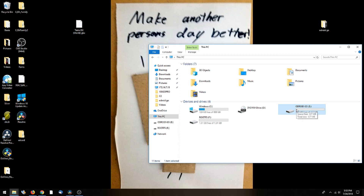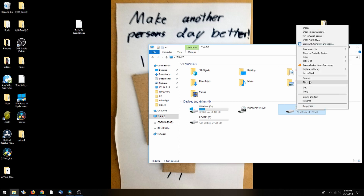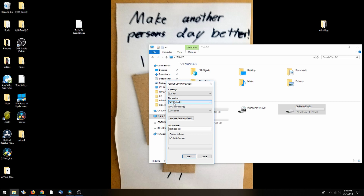Here we have our SD card. If we format it, you'll need to have it formatted as a FAT file type — it won't work as any of the others. FAT is kind of picky about the size of your SD card, so if you don't see it at first, you may need to try creating a partition that's smaller than 2 GB. Then you can go ahead and format it.